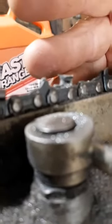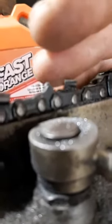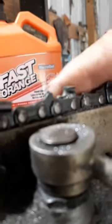You see that? I'm just barely rubbing my finger across it, and it's tearing my skin right there. You see? Little cuts. But it's sharp. Super sharp. That's how your top plate should look, Nate. If you want to know for certain what you're looking at and why you're doing something, instead of just going through the motions, that's how you can tell that top plate's too thin.